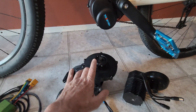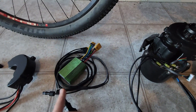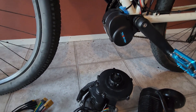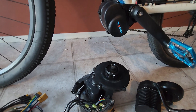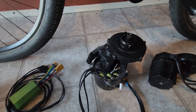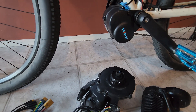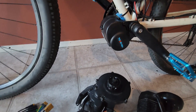With both these motors, they are kind of sacrificial in a way — they've never been run in the wild with something that can put out 4,000 watts before, so it'll be interesting to see how far we can push it. I'm going to take it nice and steady at the start with the field weakening, see how it goes, and try to find the limits. It might be that there will need to be some upgrades — maybe a peak gear, maybe some better bearings. We're really not going to know until it's done, but it's all set up and I have the temperature monitoring set up for both of these.